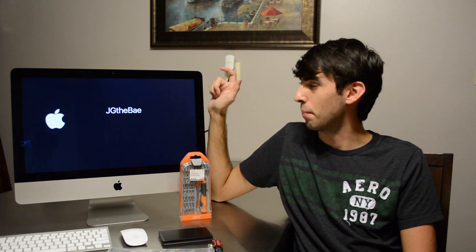I'm using my old Mac hard drive as storage and a backup — I just backup the SSD onto it. The performance is perfect, it's so much faster. It's like if you bought this Mac for the $200 or $400 SSD upgrade — it's just like that. One thing you need to remember if you are installing a non-Apple SSD — like Samsung or SanDisk — you have to enable TRIM. That's the first thing you're going to want to do. I'll have a document in the description on how to do that. Enable TRIM before installing all your programs. And if you want to, I would enable FileVault — I think that's what it's called — which encrypts the disk.